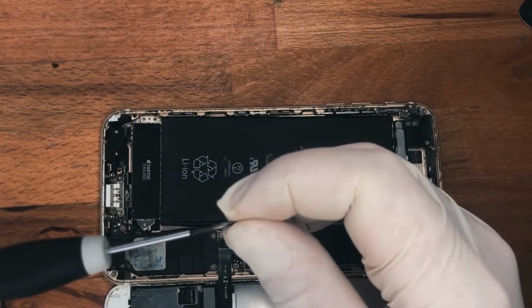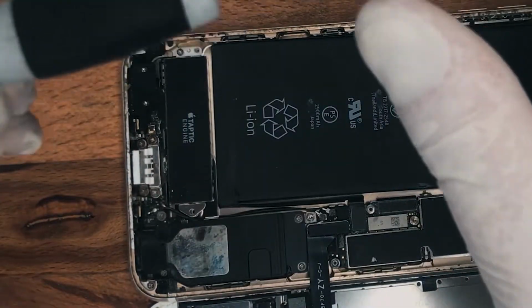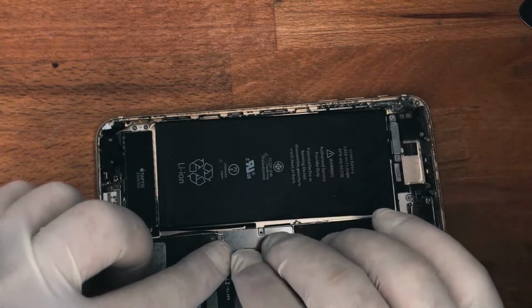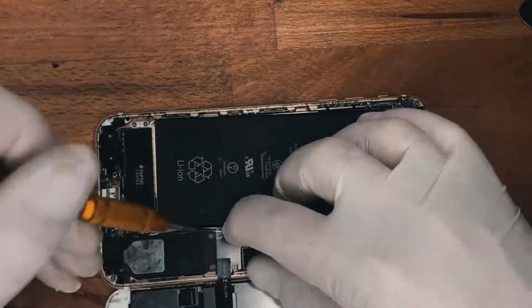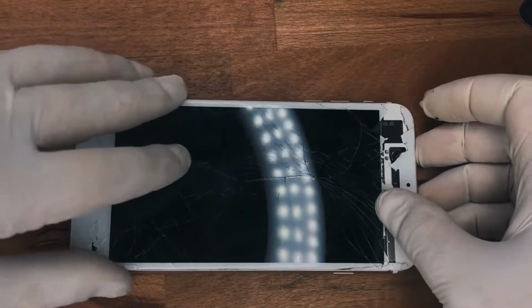We put down the 3 screws using a Phillips head screwdriver. And the plate, using a tri-point screwdriver, put in those 4 screws. This obviously secures the LCD cables and the battery cable down. We fold everything back over.